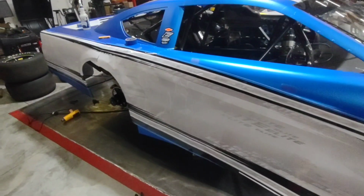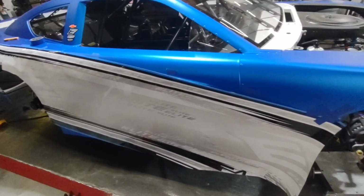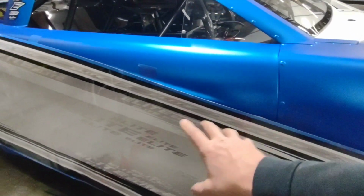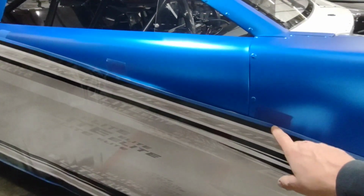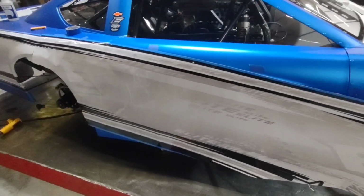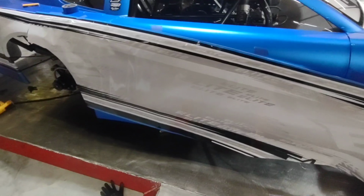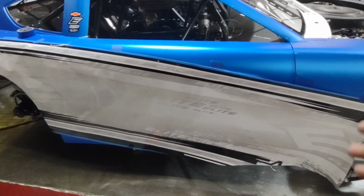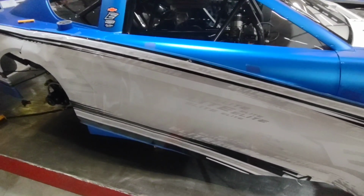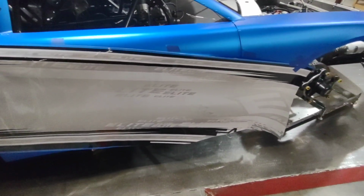When I'm wrapping a car and I'm trying to get the panel or the piece located to where I want it, I use tape and I mark where my edges are, so when I get the backing pulled off it, and I get it ready to stick, I can line it up on my marks, and it just makes it easier to align it, or register it is what we call it, registering the piece. So masking tape is cheap. It's easy to stick on. It peels off easy. It doesn't pull the sublayer of vinyl off. It doesn't tend to leave any goo or anything behind it. So it's just a nice, easy way to attach it, hold it in place, and then make marks.